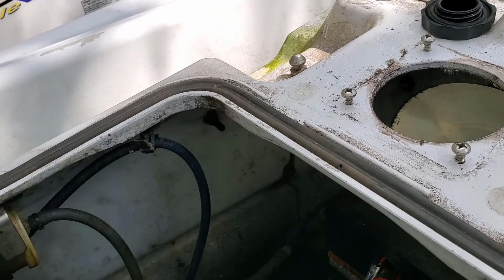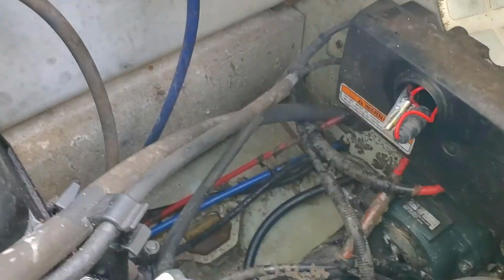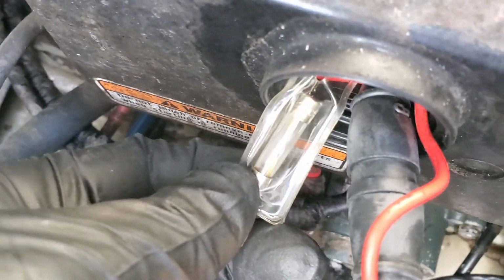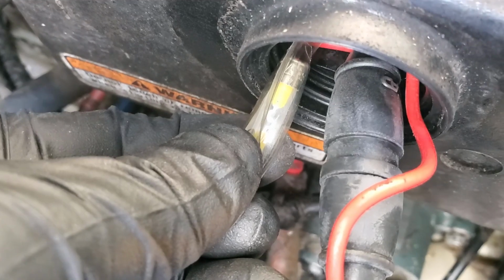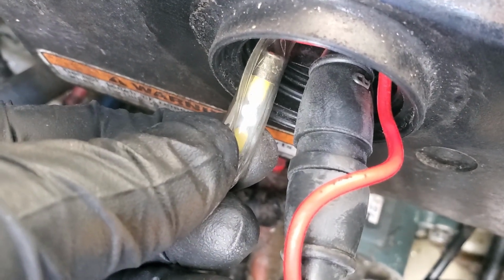All right, guys, quick update. When you're doing troubleshooting, another good thing to do, especially with something that was underwater, is check your fuses. And I can show you guys that in this one. That fuse is fine. If it wasn't fine, it'd be severed and it would have blown. So I thought maybe that's why it wasn't firing. Maybe the fuse was stopping the electrical process.